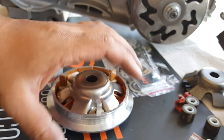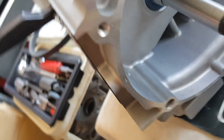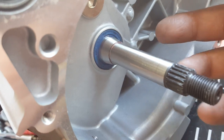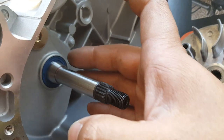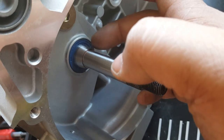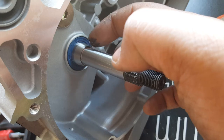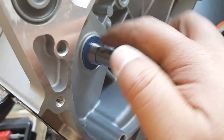If you want to be thorough, you can put a little bit of grease where it rides. By the way, we're going to also put back our starter gear — when we tighten this down, it's going to tighten our kickstart gear as well. We're going to put the variator in and put a little bit of grease outside where the kickstart gear is going. We don't want the grease to get into our kickstart gear, so let's see what that gear looks like and get it back in there before we put the variator itself.